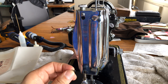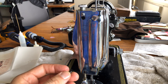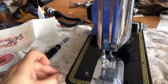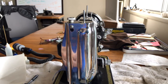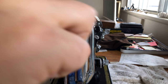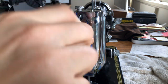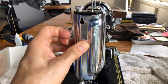Pay attention to screw lengths because if you take the screws off and they're different lengths and you don't remember, it'll save you time and aggravation. Here's the bottom one. I've got it sitting on this old towel here, so I'm going to put it down. Then when I get this next one up here — hold the plate because the plate will go falling on your machine and could scratch it if you're not careful.